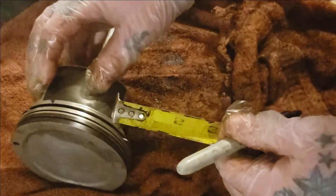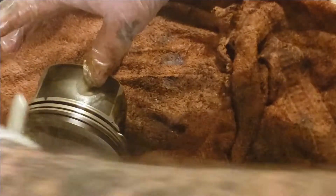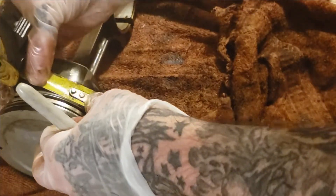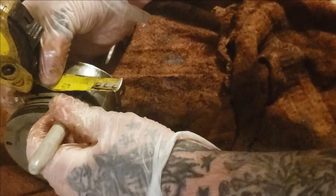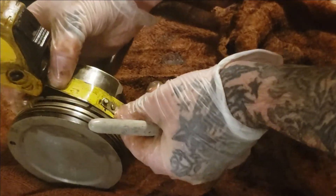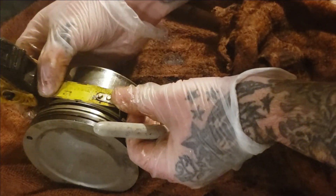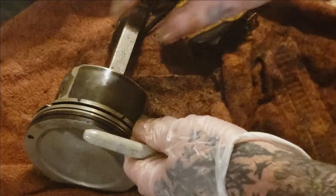You can see we're a good little ways away from that boss. Let's come over here and do the same thing to this side — inch and one eighth. And it don't have to be precise guys, you know, it's drain back holes. If you're picky then it can be. My gap is pretty well — you put it here and here, a little bit over one eighth between the dots.